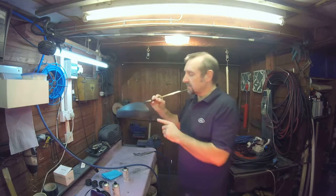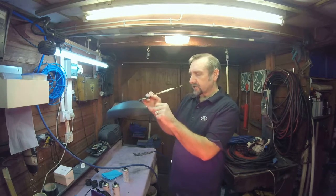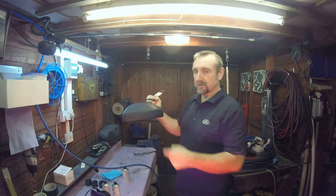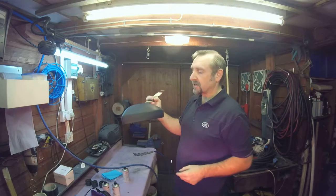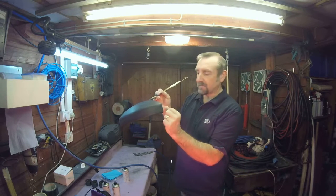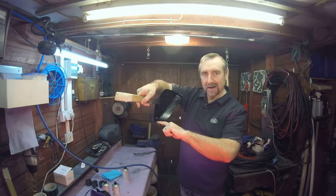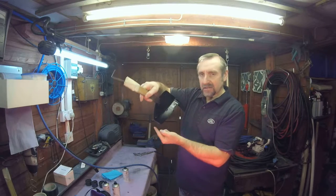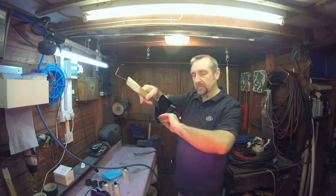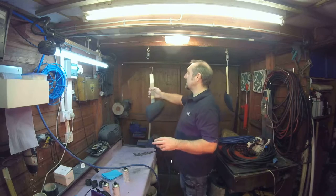paint peeling, we have to address paint peeling. If I was to only paint up to the edge of this paint here, there's nothing supporting my paint to stop it peeling off. So by the time this is doing 80 miles an hour down the motorway with flies attacking it and stone chips and whatever, it's very easy for abrasion to happen and peel the paint back. So when you paint something, paint around the corners, back onto the inside. There is no edge then for the paint to start peeling from. So it sort of encapsulates the part rather than paints up to the end of the part. That way you'll reduce any peeling.